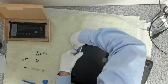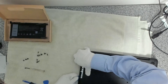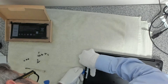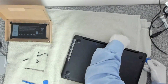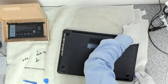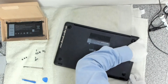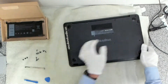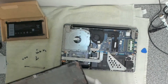You want to take your time with this. It's always better to get it released rather than breaking anything. Once we get to the front, it's just a matter of sliding the pry tool and opening it up all the way around. Then the top should just lift off — which it does.